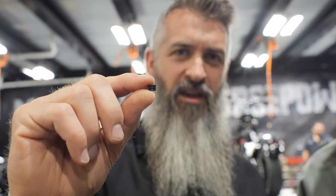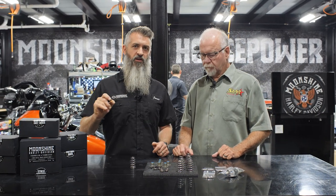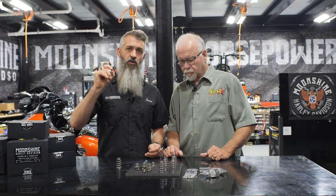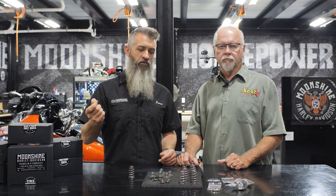These are tool steel locks and it's a triple groove. The reason these are a triple groove is because that's the way Harley-Davidson is making their factory valve stems. If you have a Harley Screaming Eagle 131 kit or a 128 with a pair of SE heads, these tool steel locks work with your valve. They're not working with every valve on the market, but this is the most common setup. George has some valves with a single groove that these won't work with, but these are designed for a factory valve stem or anything that Screaming Eagle is putting in a head, or the many valve manufacturers using the standard triple groove that Harley installs from the factory.